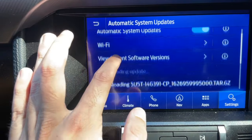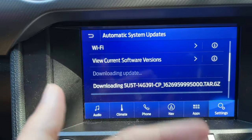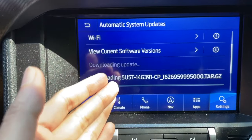It's done searching for updates, and you can see there is an updated software version available. It's downloading currently, which will take a little bit of time. Depending on how fast your internet is and where your vehicle is located relative to the Wi-Fi, it might take a while. One thing to be careful about: if you don't have strong Wi-Fi, park the car in the garage or use a hotspot, because you don't want to interrupt the update mid-process — that's not going to be pretty for your Sync system. If your Wi-Fi is going to be spotty, I suggest you try the USB version, which I'll have a tutorial on later.